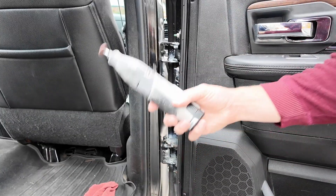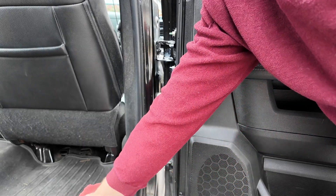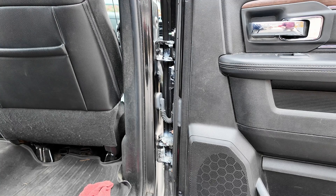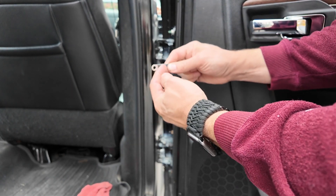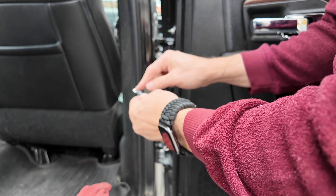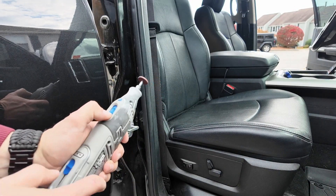With this setup, you'll need just a simple Dremel tool. What I'm going to do is find a place here where I want to bond to both of these panels. The easiest thing to do is to clean off your surface first, and then with the strap you're going to find a way to get both sides of the panel. With every grounding strap you're going to have a little ridge, and that's the ridge you want to make sure is flat to the metal because you want the best bond between the grounding strap, the screw, the washer, and the actual body itself. I'm going to pick a spot right about here and probably somewhere over here on this door, and I'm just going to use my Dremel with a grinding wheel and take the paint off.